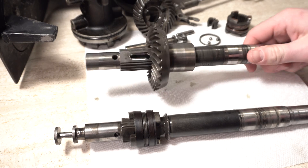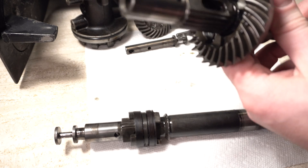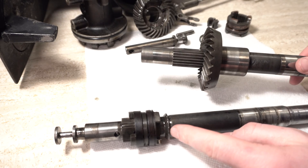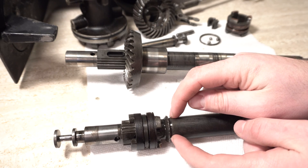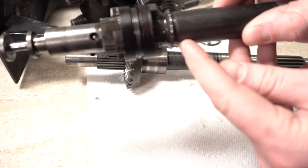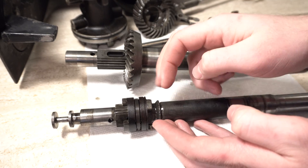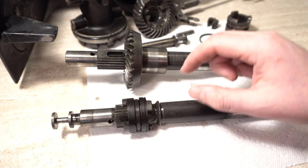When we took this apart I was perplexed why this gear was not coming off. In fact it spins, but it may be difficult to see in the video. This gear literally kind of fused itself around this groove here. Somehow it expanded and went over this — essentially, as you can see, right before the groove there's a little pit, so it kind of goes down and then up. This gear got into this area and I think it overheated or something got caught under it, causing it to deform and get stuck in this groove.